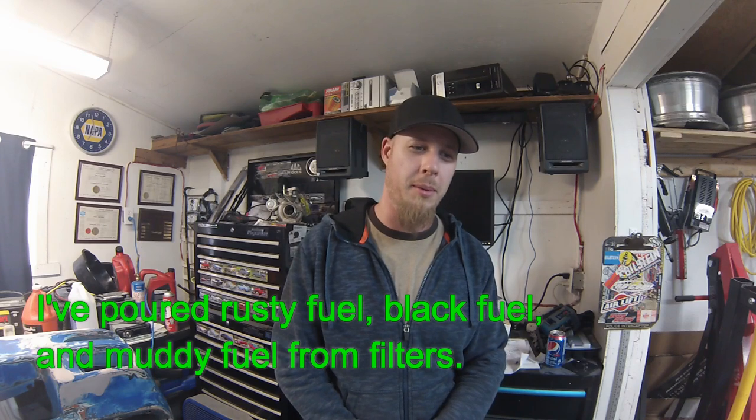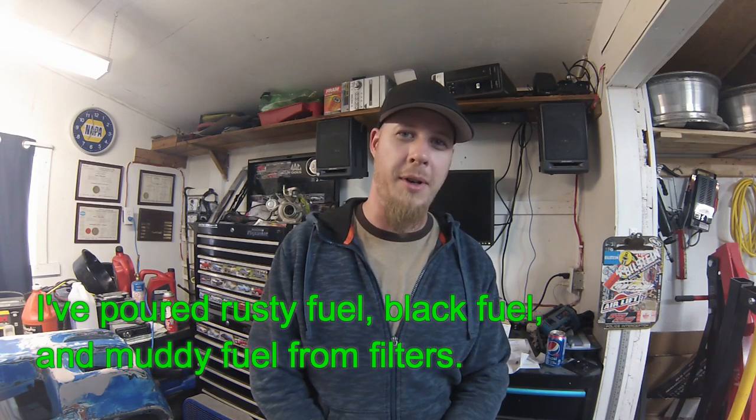Next I'll show you the fuel filter — it's fairly straightforward as well. The lines on this car gave me a hard time getting them off; probably a few minutes just on one hose working it back and forth. Sometimes they can really stick on there — I'd say the one I was taking off was original and probably about 15 years old. It's something a lot of people just don't do with a tune-up, thinking it's not really causing an issue. But I have actually worked on cars that had very little to no fuel pressure and found the filter to actually be the problem.